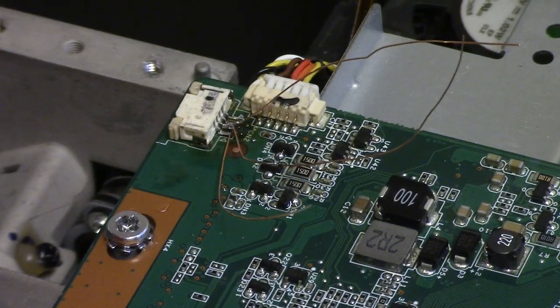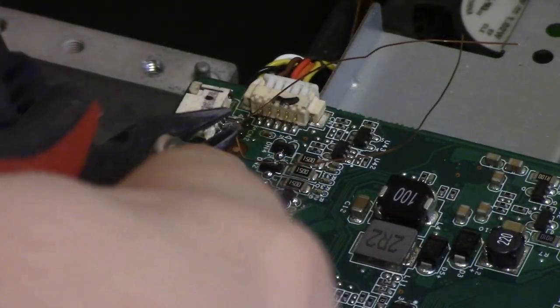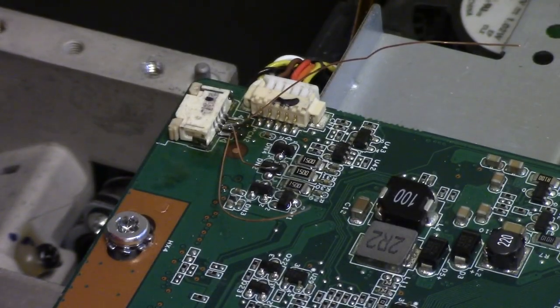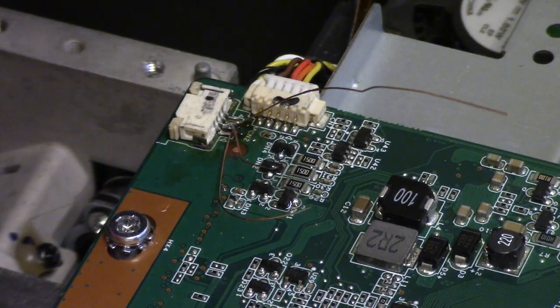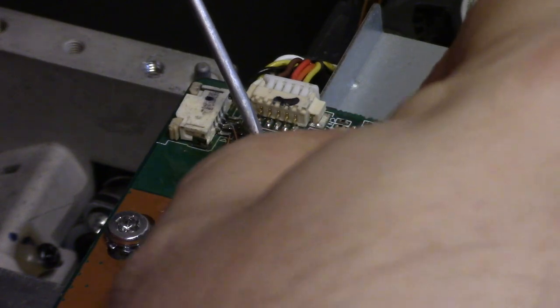What I'm doing with that enamel wire is I'm using the heat and the flux to burn through or melt through that top layer of enamel. You can use sandpaper, or a razor knife, whatever, but I found that once you get comfortable with it, doing it with just the heat of the iron tends to work really well.